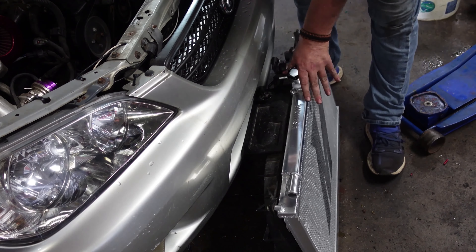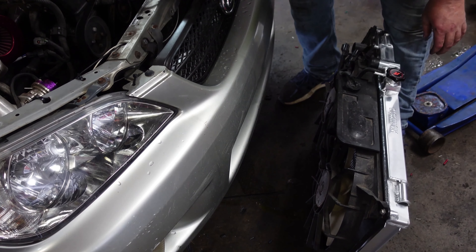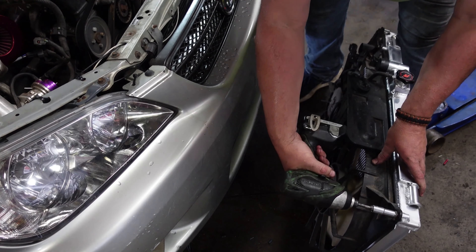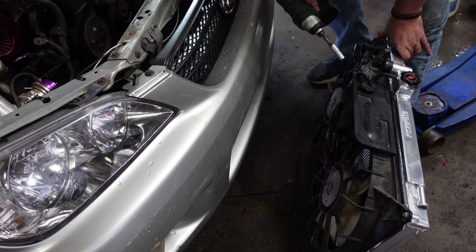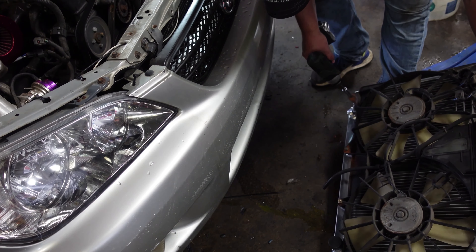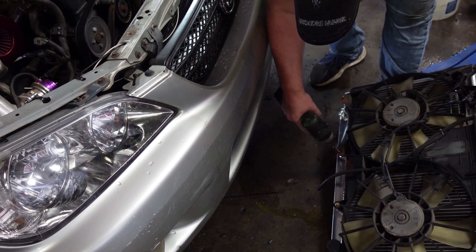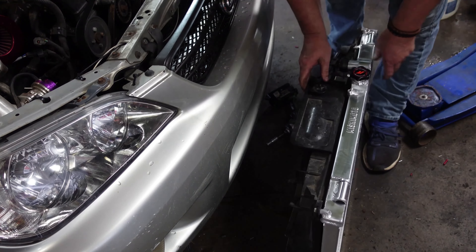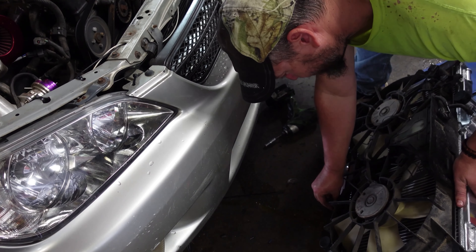My battery died. All we've done is put all the bolts in. Here's our overflow — just took it back and slipped it around there. Got some decent 10mm bolts. Remember this is an aluminum radiator so you don't have to go crazy tightening. There's a drain right there. Don't start putting everything in until you check that the drain plugs are tight — they were loose — so check both of them and make sure all your bolts are good and snug.